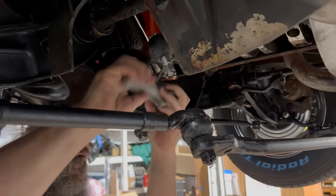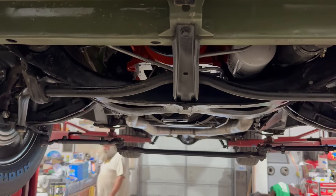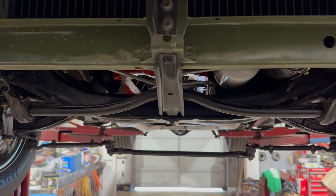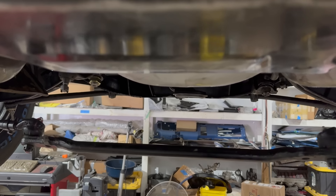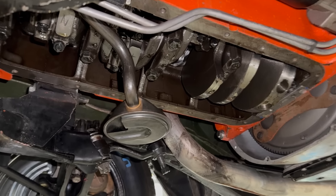Of course, when I said I was going to do that, I let Evan do it — he's less of a coward than I am. That thing was not loose in the block. These two are almost identical, but there is a height difference, and it looks like it's just about the half inch that I need. So we'll pop that one in the block. We're at just about five inches now. The fact that you can actually see it sticking below the K-frame tells me everything I need to know. And it's really, really close to level.